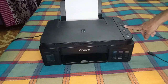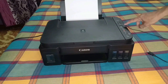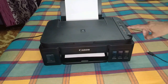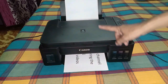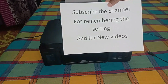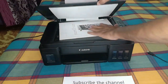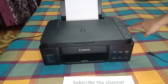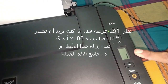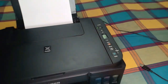This process happens because you pressed the black button for a long time. If the error is solved, the printer is ready for taking a printout. This printout comes out automatically without any given instructions or pressing a button — you can see the number '1' is displaying on the printer screen. This confirms that the E60 error has been cleared.